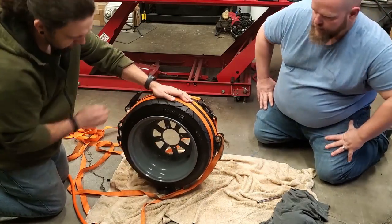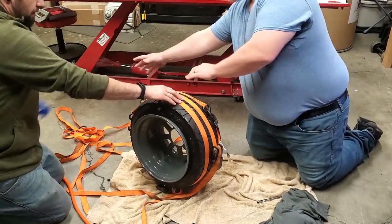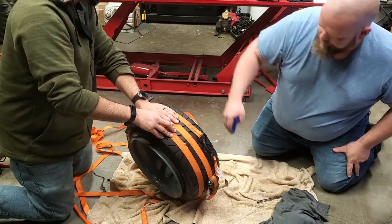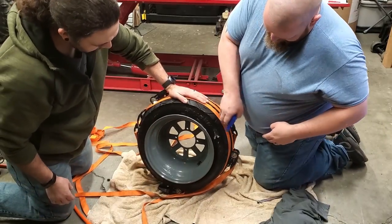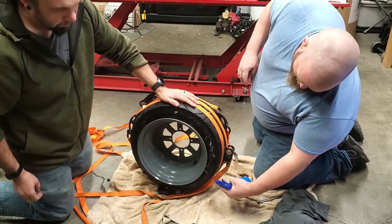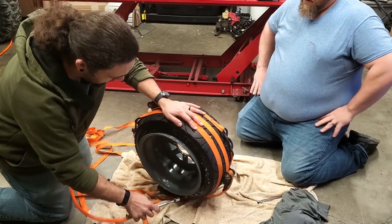Is it seating? It was the goo — we've got the spray bottle. So now we're just putting some more air pressure in it to try to get it to bead up. If we can't get it beaded, don't put too much pressure in it — and don't put your fingers in there. You can put it in front of the heater and that'll make the air expand. I had to do that on mine.